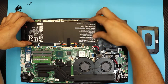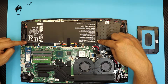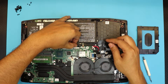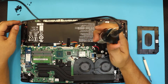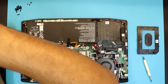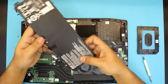To remove the battery, you have to remove two screws — there are only two screws holding it. Before removing them, pull the jack out from the board toward the battery. Now remove these two screws. Once you remove the screws, the rest is easy — just lift up the battery and that's it.